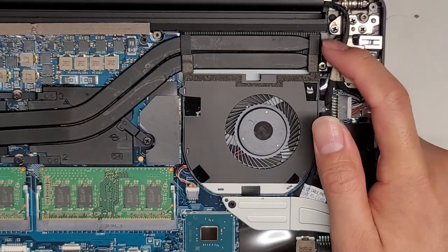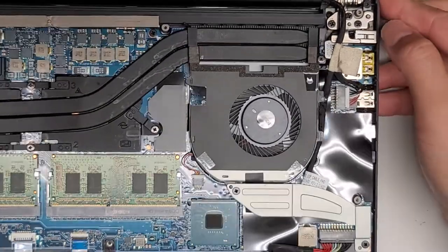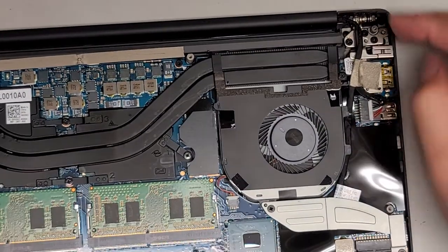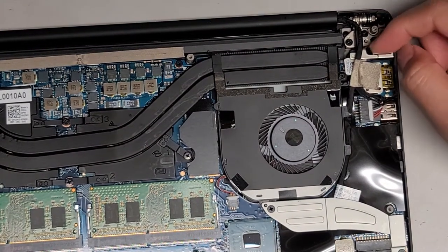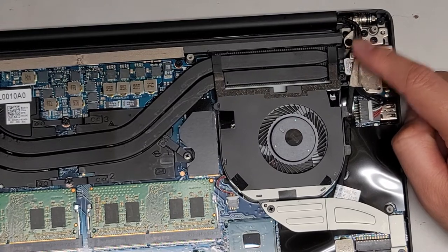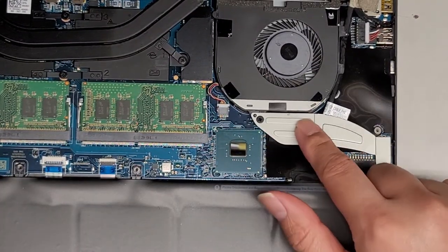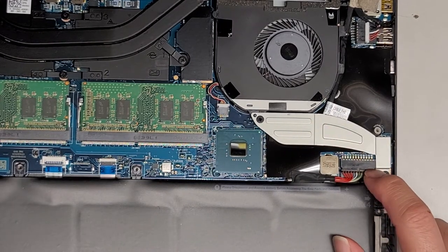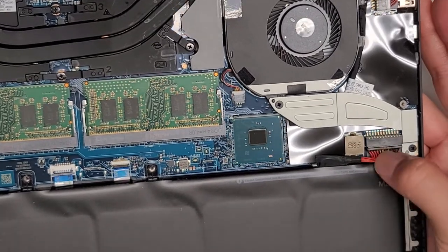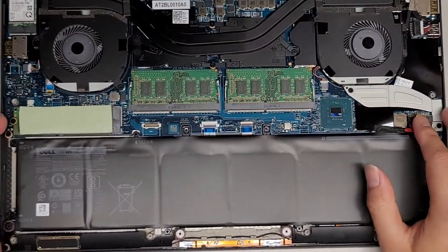To replace the charge port, you will have to remove the three screws for the hinge and then actually pull the hinge up. The easiest way is to open the lid 90 degrees first, then hang the screen off the edge of your desk and remove the screws. You will most likely also have to disconnect the LCD connector here — remove these two screws and take this bracket out. Before removing that connector, disconnect the battery and press and hold the power button for 10 to 15 seconds. You'll likely also have to remove the battery, since this cable looks like it'll be blocked by the battery, so undo the battery screws and lift the battery out.